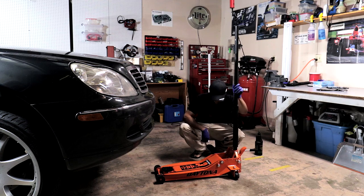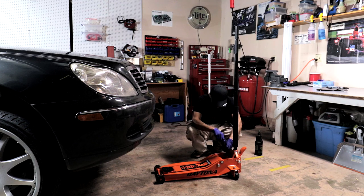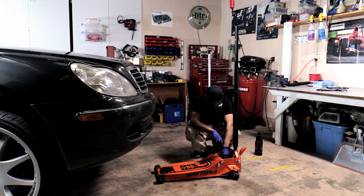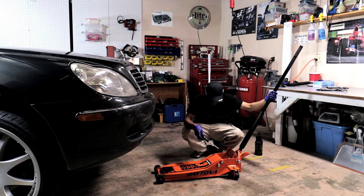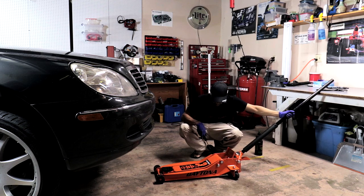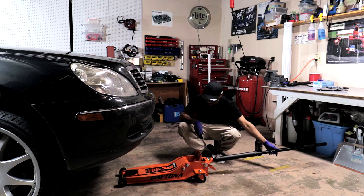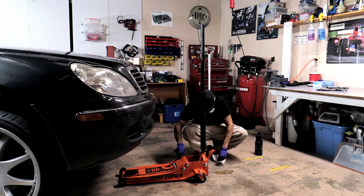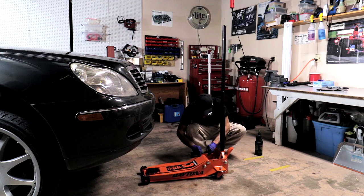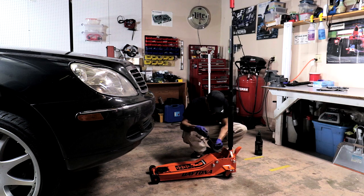And as you can see, I'm testing it out, and this is with the fill bolt back. So now I'm removing the fill bolt just to get some more air out, and maybe I have too much fluid in there. So what I'm doing now is, I'm just extending it all the way back and letting some of that fluid come out, and also some of that air. So you can see that puddle right there where there's a lot of fluid on the floor. So just dialing it in some more, and you can have the fluid at the proper level.